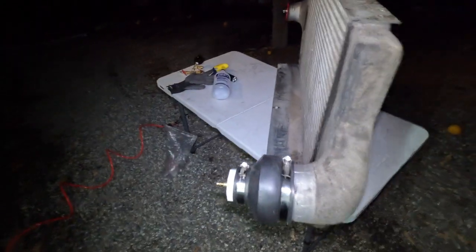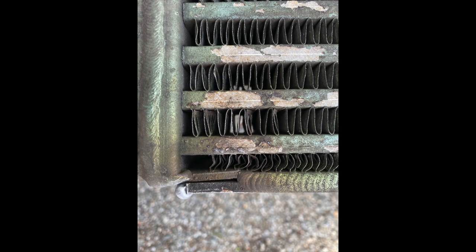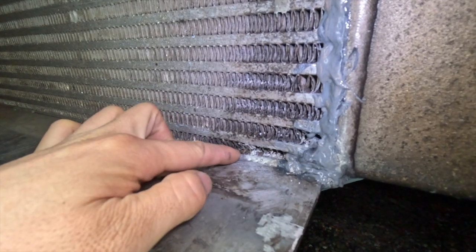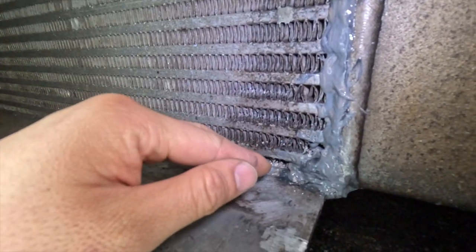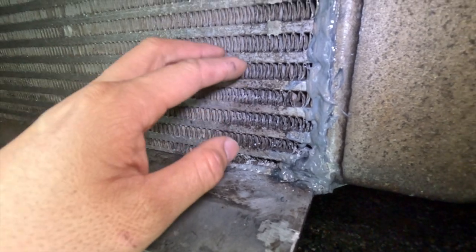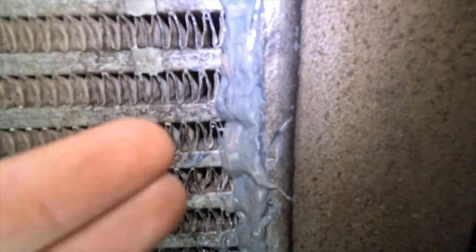Here's my charged air cooler, or CAC for short. This thing has been leaking air. The cause of it is on this corner here — a piece broke. The stress, instead of exerting on the structural piece and the tank itself, was on these tubes. Those tubes are obviously not designed for taking that weight. It started to shear. I had a professional welder weld up this part. You can see the shiny parts that are new welds, and he also helped weld up those little cracks.